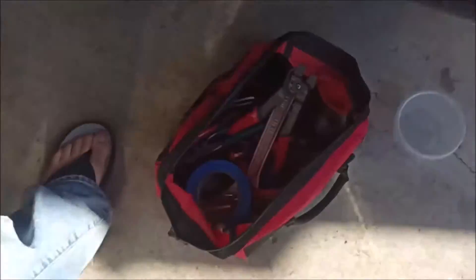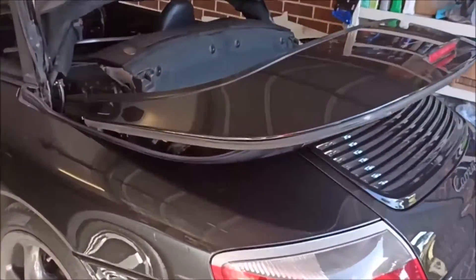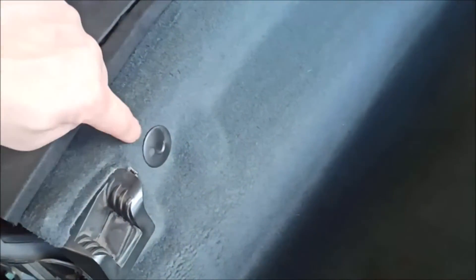When you look down here you see that little ball - we're just going to flick that off. The video cut out for some reason, but we've got the little ball joints popped out on both sides. Once you've done that you can just flip the rear window up on itself. When putting things back, just pop the ball joints back on. Now this bit of carpet needs to come out - most of it is fairly loose and there are just four little plastic clips to pop loose.